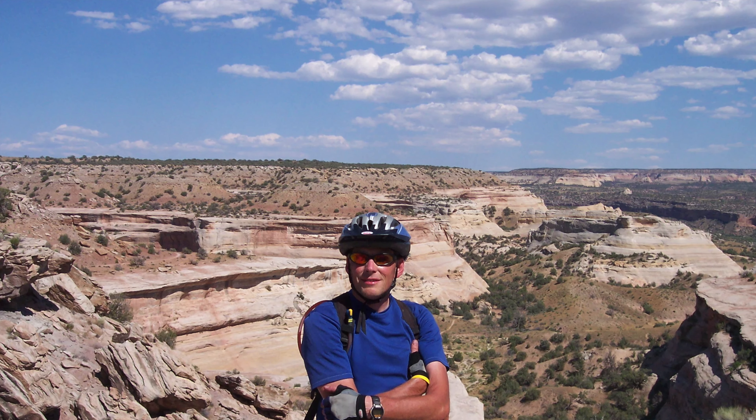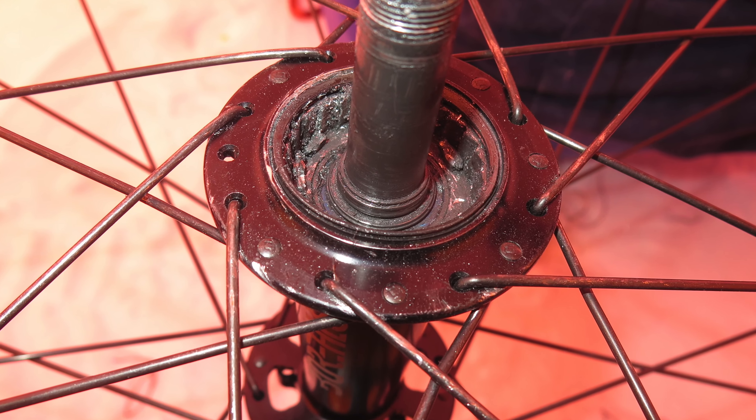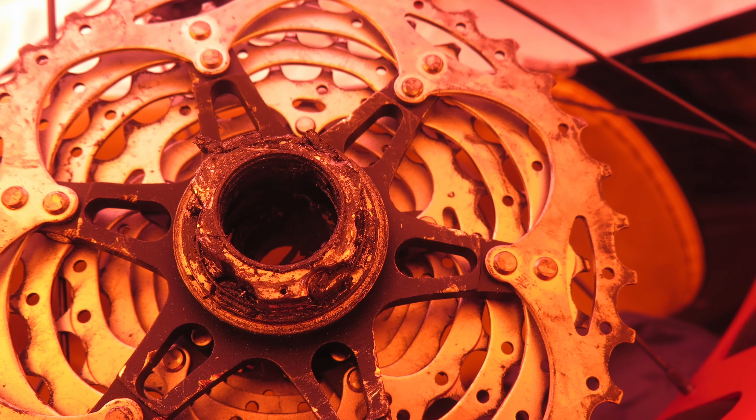Without the ability to coast, I could no longer adjust where the pedals were for starting. I could still do it by lifting the rear wheel and pedaling to the right spot and then getting started, so it was still possible, but much more difficult. One of the really cool things about the hub I had was I could take it apart and service it without using any tools. I took the rear hub apart, and it turned out the metal had gotten too brittle and broken off the part that holds the pawl in place, jamming it so it wouldn't coast anymore. It was a pretty easy fix — I pulled out the broken pieces, cleaned it out, and put it all back together.